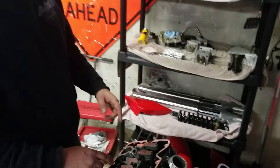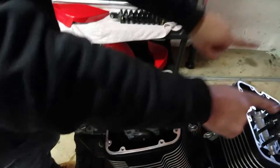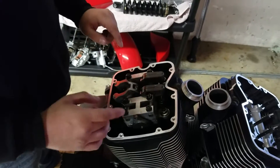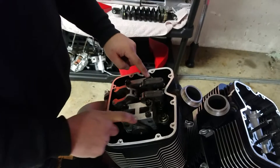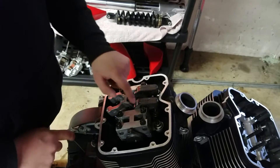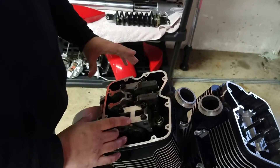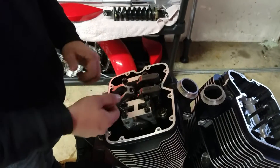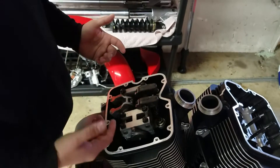Here's what we're going to show you. If you come over here, this is the engine and we're facing this way. The front of the motor is here. The torque sequence is: this is number one, number two, number three, number four, number five, and number six. You're going to want to torque those bolts down to 20 foot pounds. But the main thing is just snug them up first — don't go straight into torquing them. You want to make sure that everything is leveled in when you're getting this put in.